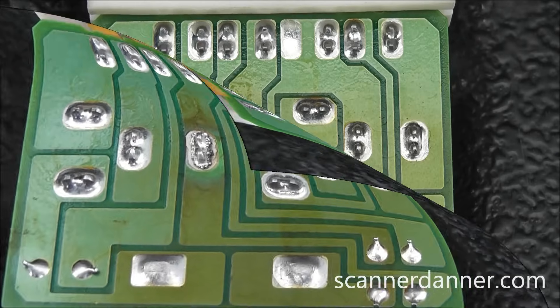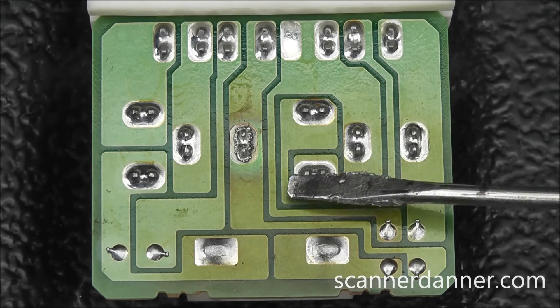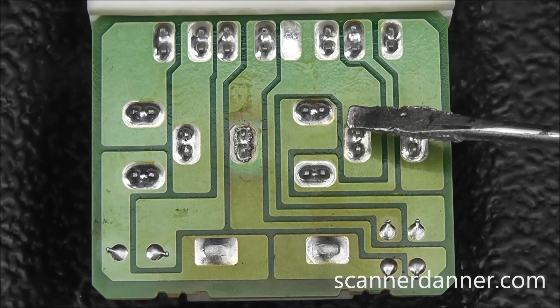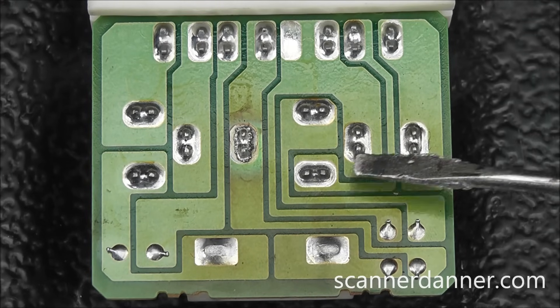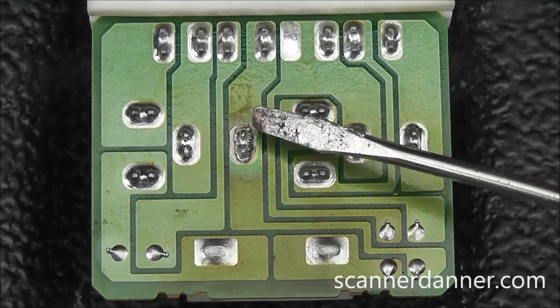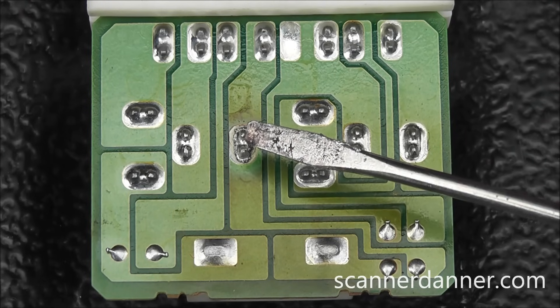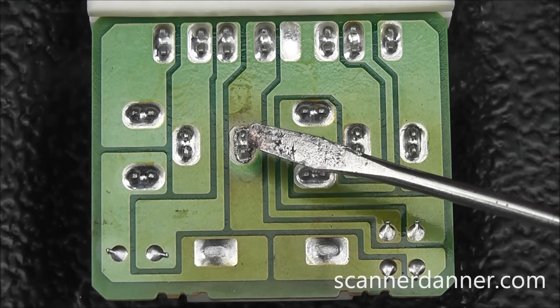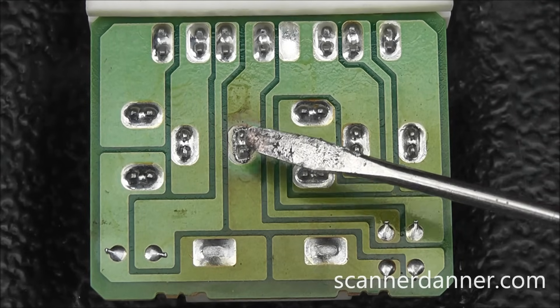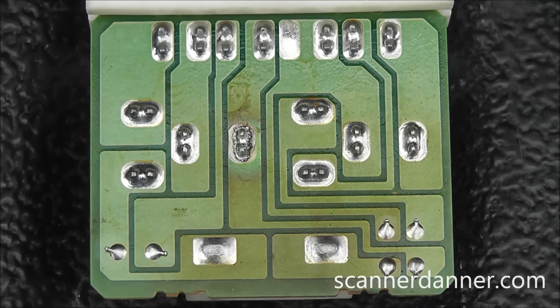I'm going to inspect the rest of these closely. The reason why this one is actually melted is because with this crack, over time it's cracked all the way around. What we do is we generate resistance there, and with resistance in an unwanted location it actually makes heat — and that's what melts it. The cracking itself is just from expansion and contraction over and over, over thousands of miles and on/off key cycles. Any circuit board has this situation. It's not unique to Honda; it just happens to be common on this one because of their design.